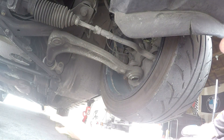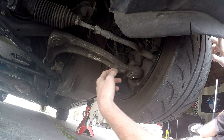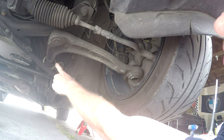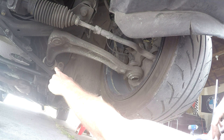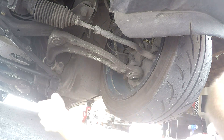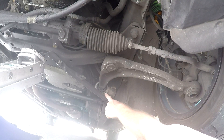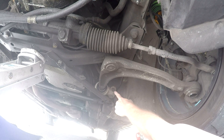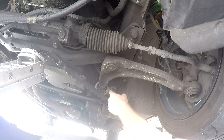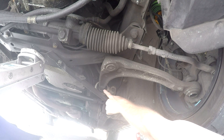Okay so we are under the front of the E46 right now. This is the driver front wheel. Here is our front lower control arm — this is a complete assembly that goes from here to the ball joint in the knuckle, here to the front subframe, and then back here which is the main area — the front control arm bushing right back there. I have no idea if these have been replaced with OEM or OEM replacements, or if they're original. Hopefully you can see this guy right here is what we're replacing. It's basically a rubber bushing inside a carrier which mounts up to the chassis.